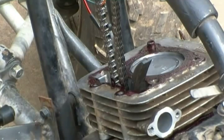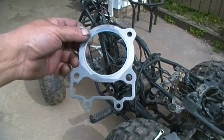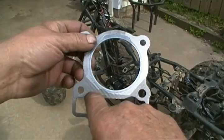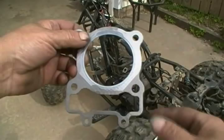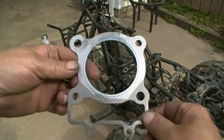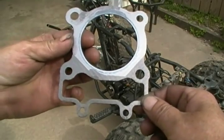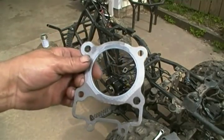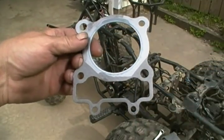We got that surface coated up, and I'm getting ready to put the gasket on. I'm just going to show you something here — these are the little things you got to look for. Notice how this gasket has these two little holes right here. Well, this one is actually higher than this one, so you got to be sure you put that on the motor accordingly so that they match. I don't know what the reason for that is, but I'm sure there's a reason for it. Taking care, we notice that this one goes to the front. I already looked at the block there, so I'm going to put that on and then paint this surface and put the head on.